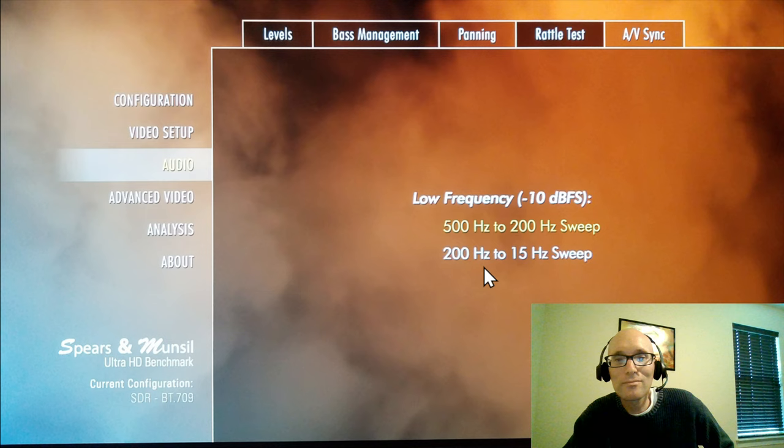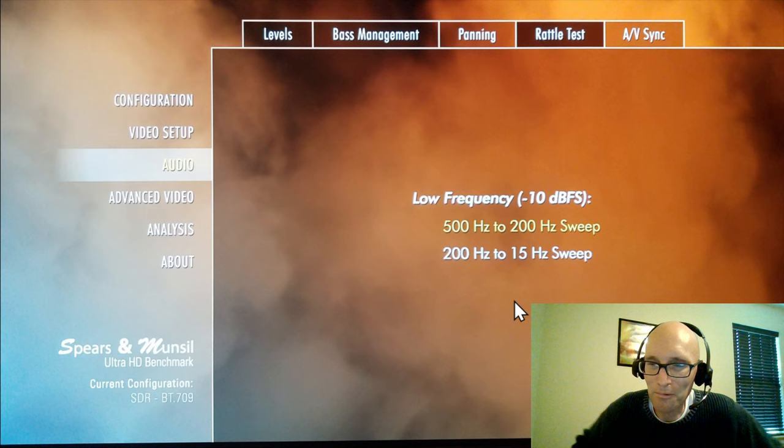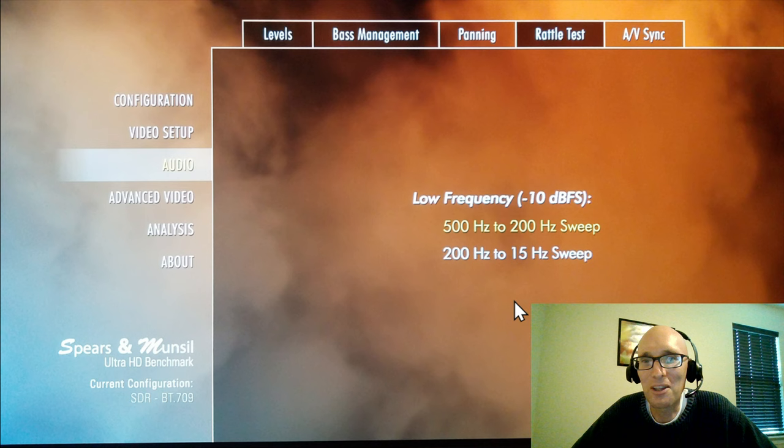But around 157, I think it's the speaker though, so it may need padding out. I don't want to put anything in the back of that air pocket of the woofer, because that actually changes the EQ of the speaker significantly and reduces the load on the speaker. You just can't produce the bass if you stuff the back port with anything like that. But yeah, I think it's the speaker. I'm going to have to check, but I don't like things that rattle in my room. I hate that. But you have this, which is good.